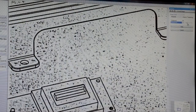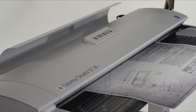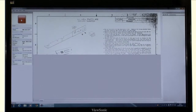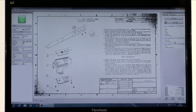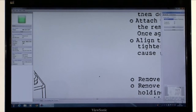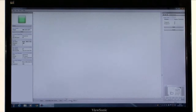SmartWorks Pro has the ability to clean up originals and to convert images to black and white. Take this dirty CAD drawing for instance. With SmartWorks Pro in Scan and Copy mode, scan the original in BW CAD Copy preset. Select Thresholding and enable 4-View. The 4 additional movable Zoom View Preview tabs can be positioned around the image to assist finding the best setting when editing.